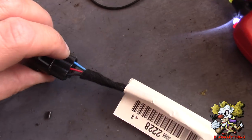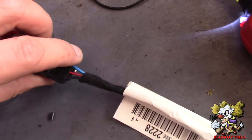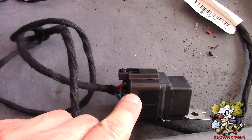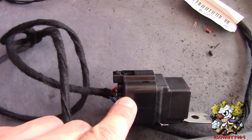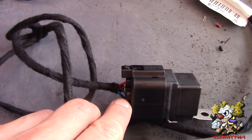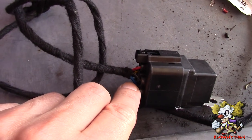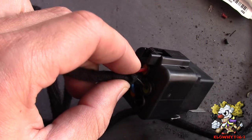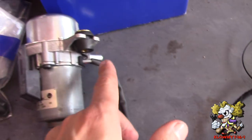The blue-green thick wire goes straight to the relay - that's the 12 volt main power wire and it needs a 15 amp fuse. From there, that blue thick wire gets connected to the red and white wire, and that red and white wire feeds the juice to the pump.